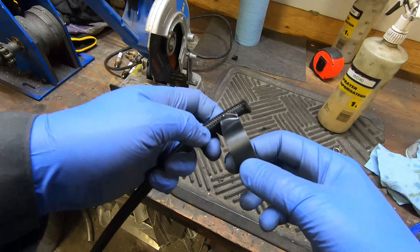If I was to do this again, I would just use a bulkhead fitting on either side - that would have been way faster, way easier, and work just as well. It's pretty hot right now - that's the bung that's welded on, and the dash-12 fitting goes on it. I put some JB weld on there, partly to hide the ugly weld and partly just to fill any pinholes if there are any. I think it will function. I'll put this together now, put the pan back up, and that's pretty much it for the oil lines. I'm waiting for the 45-degree fitting, but otherwise the lines are all done.